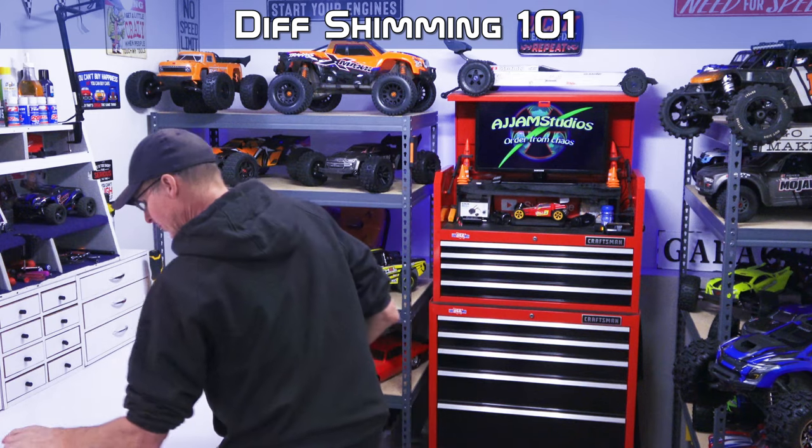In this video, we're going to dig right down inside of one of these. We're going to pull the differential out. We're going to get it all the way out of the mechanism here, show you how it seats in there, how things sit. We'll get the pinion out, and we'll show you the spacing, what you should have in there, and then we'll put it together and show you how they should go in and how you check them to make sure you got them in roughly the right place. It's impossible to get a caliper down in there, so a lot of it is eyeball and listening. So let's get on the bench and get started.